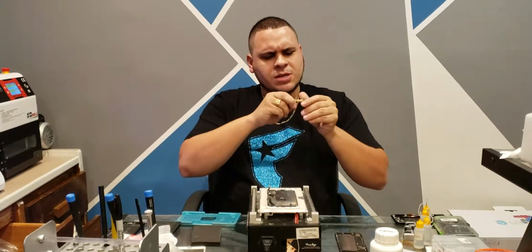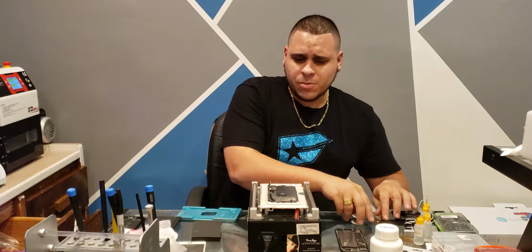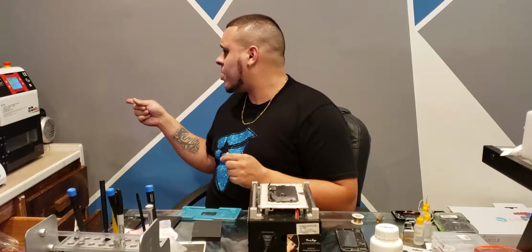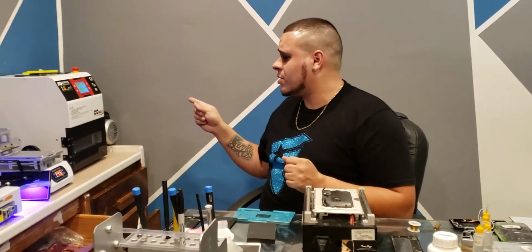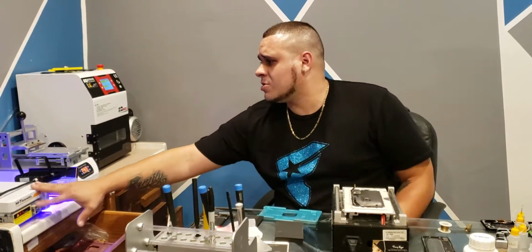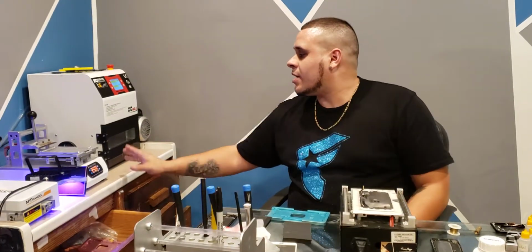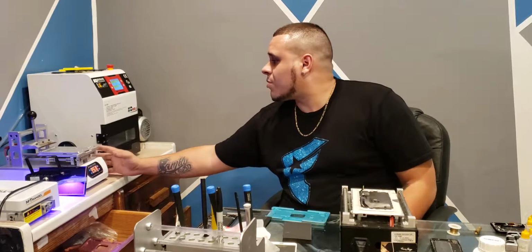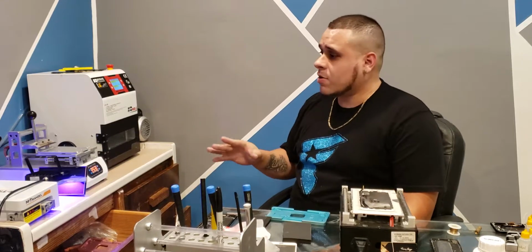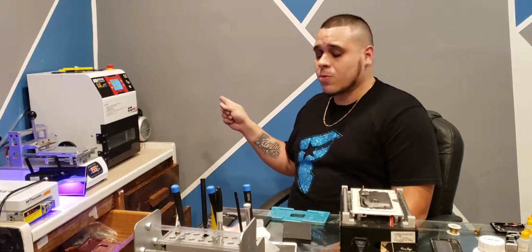There's really not that many videos on this stuff, but I don't know if you can see in the camera, we're going to be using the KO number 2 machine, a $100 vacuum pump. I'm thinking about upgrading that to get rid of some bubble issues. I had a small autoclave here. It's supposed to be just as good as the big one, just can only do like 2 phones. Really only 1 phone, but I fit 2 sometimes. And we've got just a regular polarizer remover everybody uses, and a humidifier. Everything is good. The only part of the system that I cheaped out on would be that vacuum pump, but I've got a new one coming tomorrow.